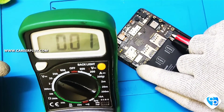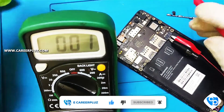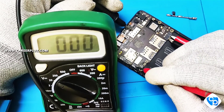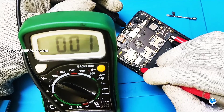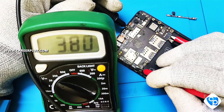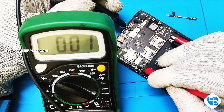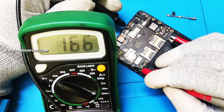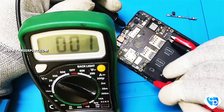There are five pins in this strip — it varies according to different mobile phones. The strip should match correctly. The first pin shows 3.8 volts. I won't get any voltage for the other pins because volume up and volume down buttons share the same ground pin, and all other pins won't get voltage as the mobile is powered off — voltage will come once the mobile is powered on through the power gate supply.